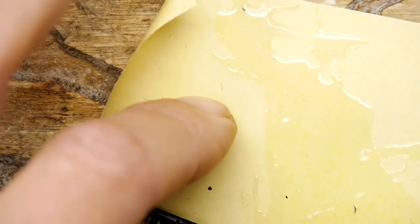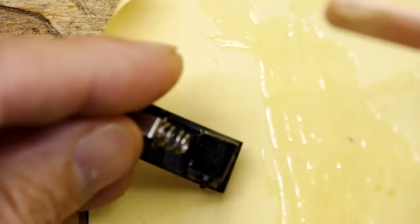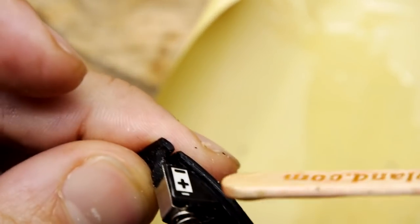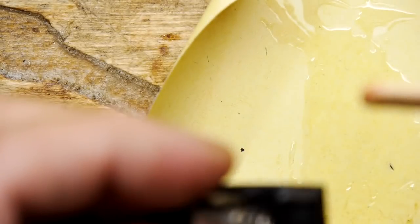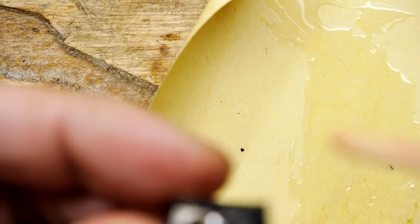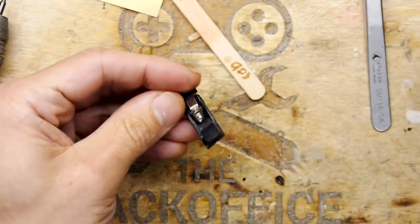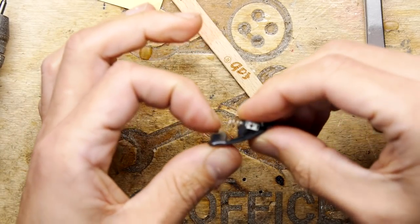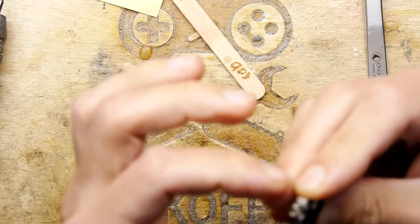And if you want to belt and braces, you've still got the resin mixed. Get a little bit of extra resin if you've got a means of getting it in there nicely. You could always try to scoop a little extra dollop there on the back. I'm looking at it though. I kind of think I'm probably not going to be able to. Maybe I'll just leave that alone for now. So I'm just going to leave this to sit for 5 minutes, 10 minutes. Let that set, and then we're going to shape that, and hopefully get a pin through it somehow.